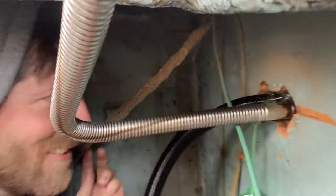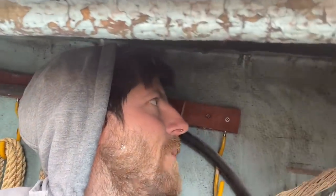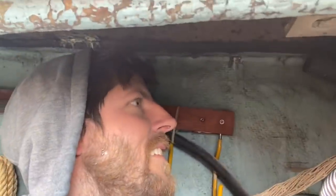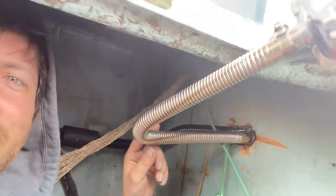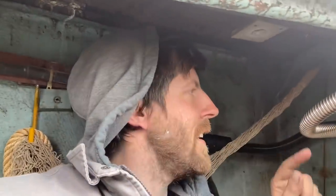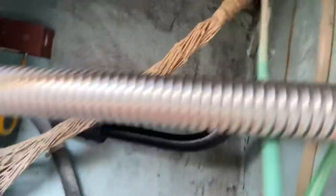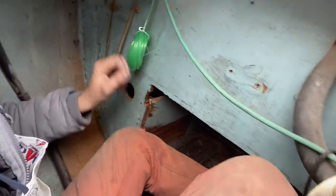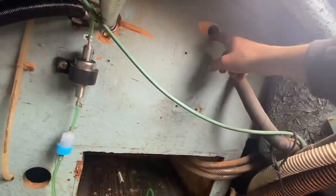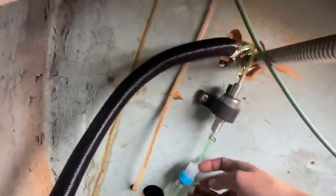Now I'm connecting my hoses. This is the air intake, for combustion. So I'll probably just mount this up here. And then the exhaust, I'm going to get a double-walled version of this and also a longer one so it can run out the back. But this is mounted up for testing purposes. It's got a little muffler, and those are just hose clamped onto here. And then we got the fuel line, and my fuel tank goes right where my leg is here. We just drilled one more hole for the wiring to go, and that'll attach to this little mini fuel pump.